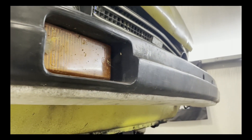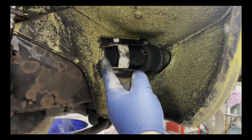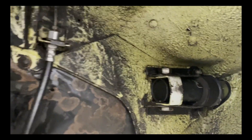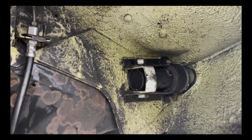You've got to disconnect the little lights in the bumper, but other than that the front bumper comes right off. The rear bumper is held on the same way, but it's much easier because those brackets are actually in the trunk, so you just open the trunk, remove them, and the rear bumper slides out.